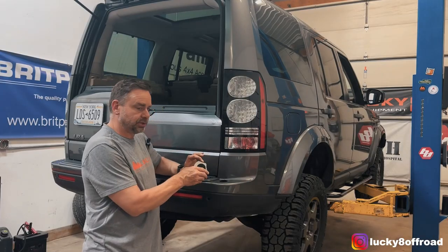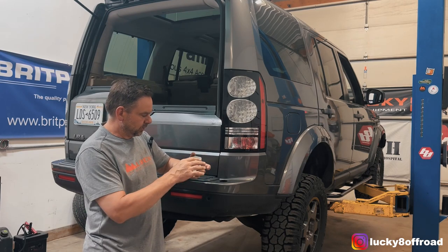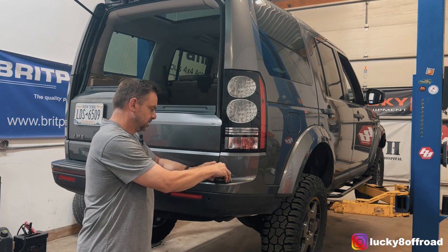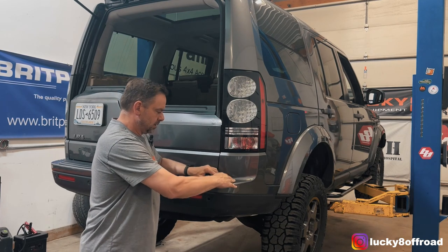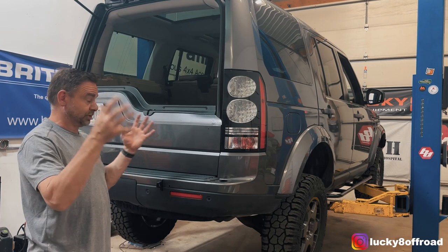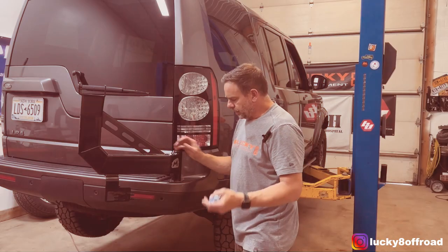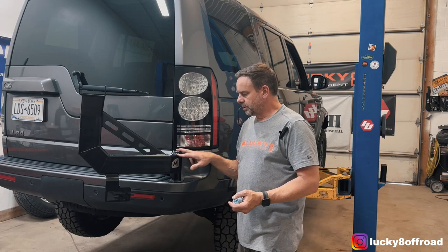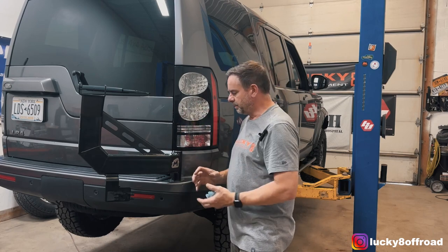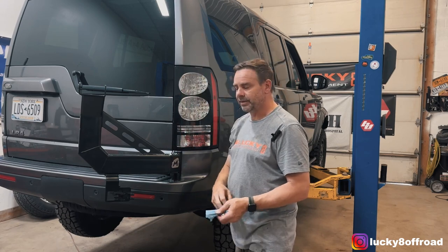We are in the home stretch. Next thing to do is cut out the little sticker — they give you a template, you cut it out, and you stick it to the little oopsie plate or vanity plate. We're going to do this one and this one here. With that done, I can now set on the actual swing away itself. Quick side note: there's a bolt and a large washer that holds the tire carrier down. To get the bolt started, it's a little bit easier to maybe wiggle the tire carrier up a bit. You're supposed to put some Loctite on it so it doesn't come loose — that way you don't hit a bump and have your tire carrier leave the vehicle.